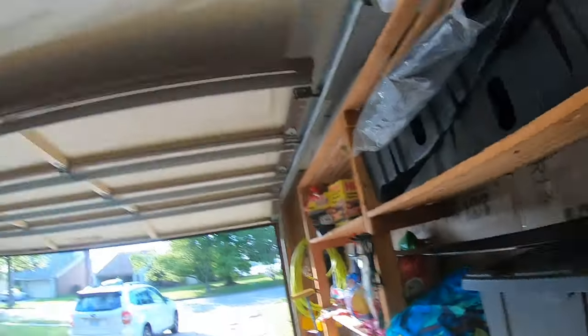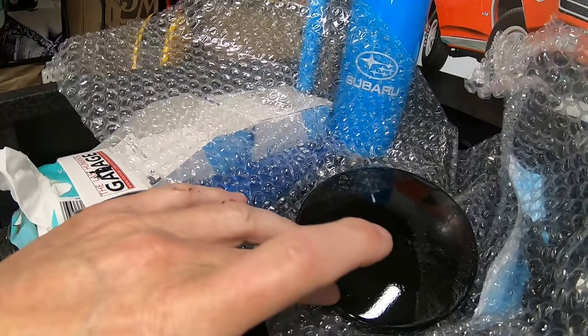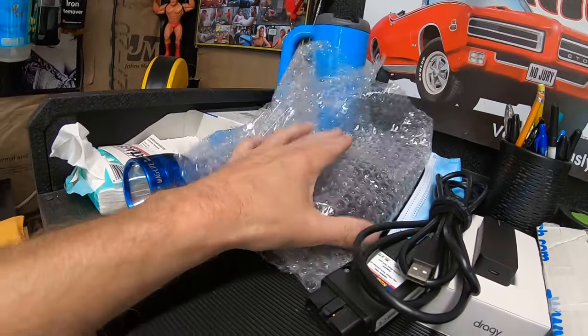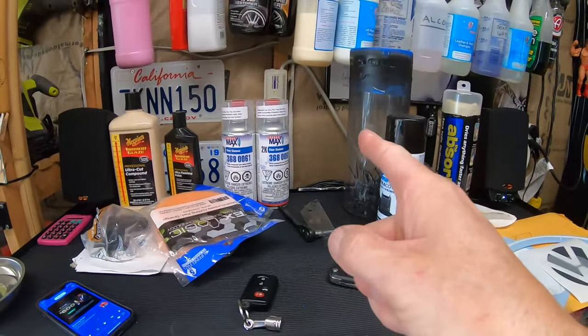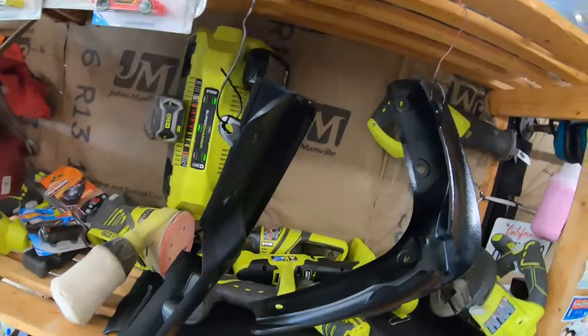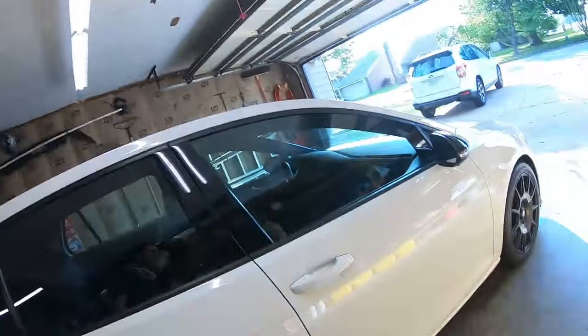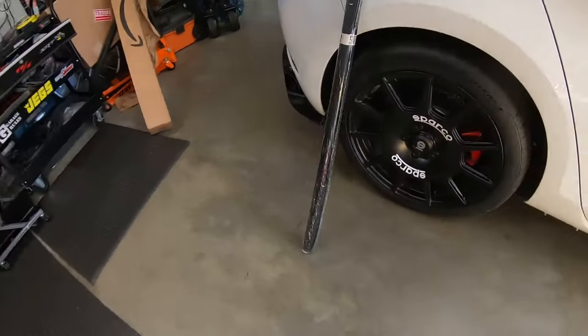Still working on my side molding project, so I've been running road warrior style which I like. While my gloss painted cherry moldings await their Spray Max 2K clear coat — the best clear coat in the world — going on those. I haven't done it because I'm waiting for my vinyls for my front emblem. Once I get the vinyl done I'll pop my clear, which is only good for 48 hours once you mix it with the hardener. I'm also going to clear my two flaps that are super gloss black cherry — those are going back on the fronts only.